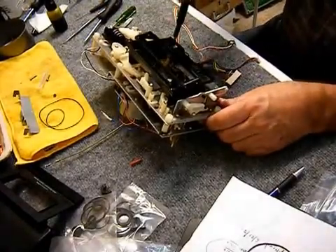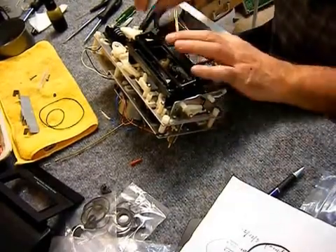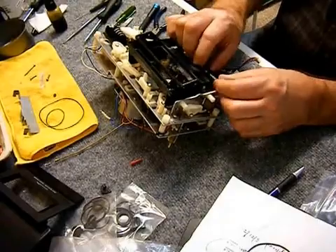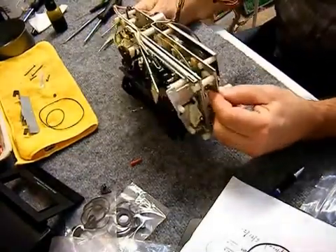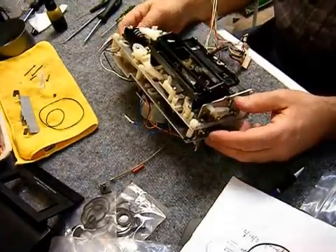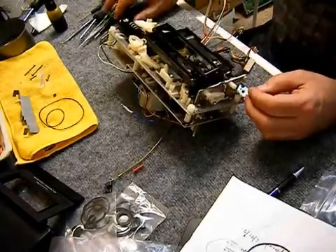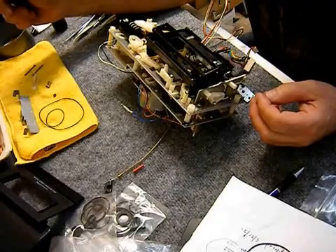Removing the beauty plate and taking off the counter belt — all the rubber parts get replaced here. I'm looking at the pinch rollers and noticing they are frozen in place, so I have to remove the pinch roller arms, re-lubricate them, put them back in place, and adjust the height of those pinch rollers using the reference plate.